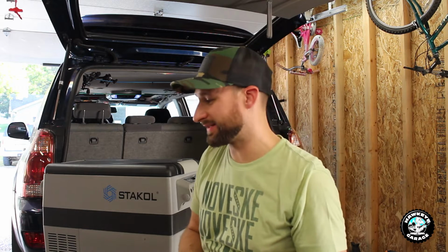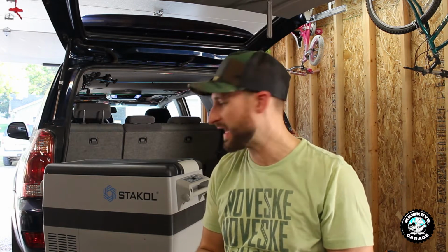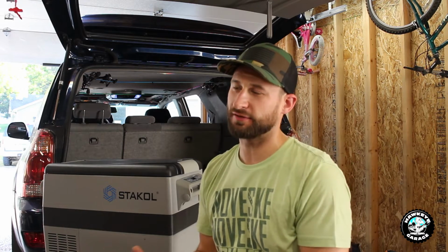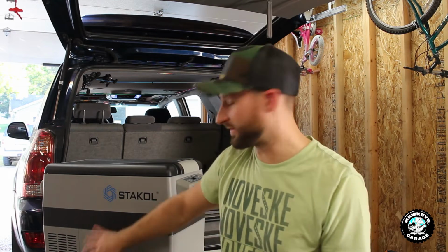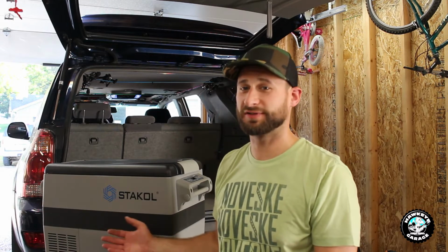It's a little bit louder than your average mini fridge. I can't convey that to you on video very well. So there's that. It's not loud by any stretch of the imagination. The temperature fluctuations, so if you have it set at, let's say, 32 degrees, it will usually cool down to 28, give or take, and then it will usually go up to about 36, give or take, before it kicks back on. Everything that I've read, even on the high-end refrigerators, that seems like that's the common thing. That's what they all do. These aren't insulated very well. My Arctic cooler's got more insulation than this.